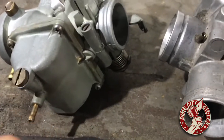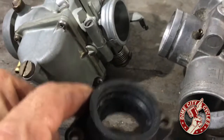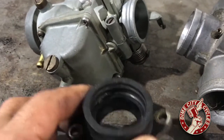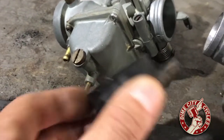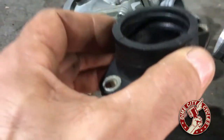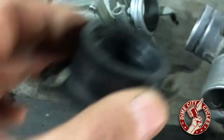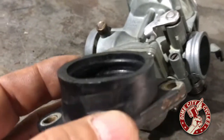So you have to find aftermarket — and we do carry aftermarket Mikuni rubber intake manifolds for your CB350 — but they're designed slightly different; they're not the same. I don't think they're angled quite as much as these. Nonetheless, if these are in good shape and you wanted to use them with your Mikuni carburetor, Mr. Scott Turner has come up with a way to do this.